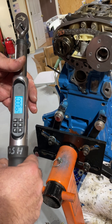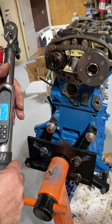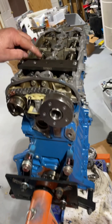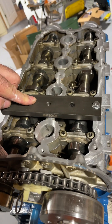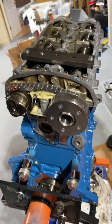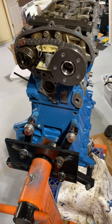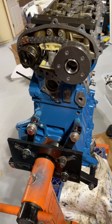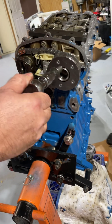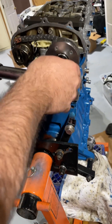Sorry, I had it calibrated but it sat too long. You need this special tool in here to keep the cams perfectly aligned, and then that other little tool just to move the chain that little itty-bitty bit. Watch, this thing is so sensitive — there we go. So 20 Newton meters, 45 degrees. I did put a little bit of anti-seize in there.